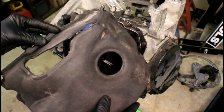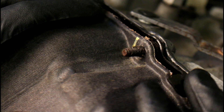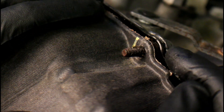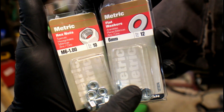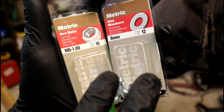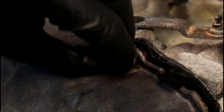At this point we're ready to install the insulated cover — guide it over the dipstick tube and work it down and around the connector for the transmission's valve body. If you remember, in the beginning we had to cut the three clips off that held that insulated cover to the three 10-millimeter studs. Since we don't have the clips to go back with, here's the solution: you're going to need some 6-millimeter by 1.0 nuts and 6-millimeter washers. Slide the washers on then tighten up the nuts — that way we can take it off in the future if needed and we don't have to use those clips we had to cut off.